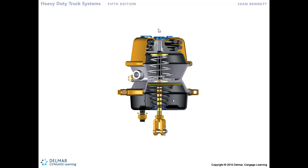This piston would be cleared down at the bottom. The bolt extends down through a machined hole in the middle of that piston all the way through. Then we give a quarter turn on the caging bolt with our fingers — it spins around and those lugs engage the piston, locking it in place. We thread the nut with the washer on it, and as we thread that nut down, it pulls the piston back, compressing the park brake spring all the way until it is fully retracted. We have now manually caged that spring.